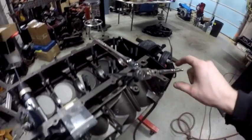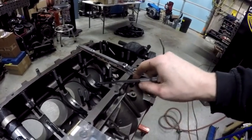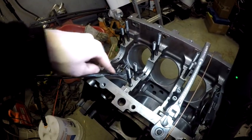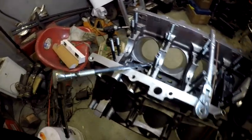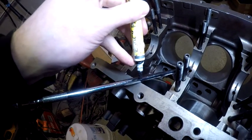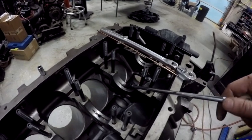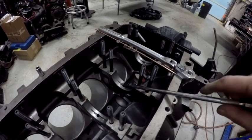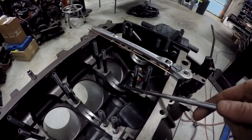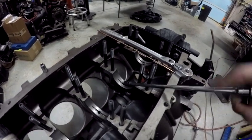Right about where it feels like it's going to start cutting, hold the ratchet up and count your revolutions. You can put a sharpie mark on your extension to track how many times it goes around — I like that better. On this one we're going to count four revolutions. Back it off and give it another test to confirm the depth is correct.